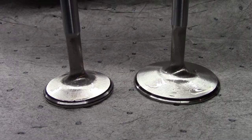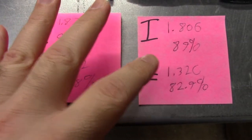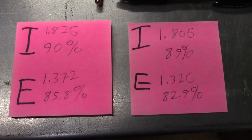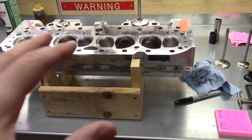Here's a better shot of the valves. I measured the throats — you can see here's a comparison: this is the new head and this is the old head. You can see the intake got just a little bigger and the exhaust a few bigger. Good for the exhaust. Intake I'm still not too hot on that size, but it is a 180cc intake runner so it has a little bit more velocity — it could probably get away with a little bigger throat. The SHP is a budget head; it is not as good as the Platinum Pros, it is a lower quality alloy — not championship engine components.